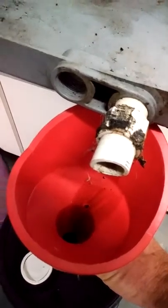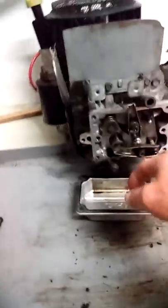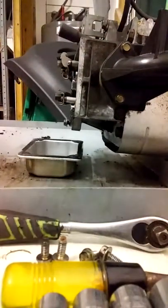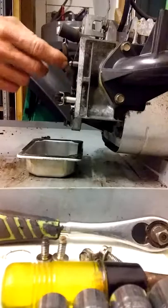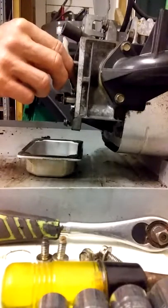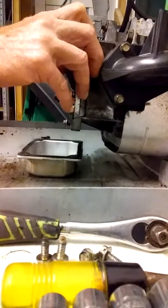If it overflows, I can catch everything with this pan. But there's a problem right here — that little valve was just like that when I pulled the cover off. The bottom valve is not moving at all. My push rod — watch this one, you can see my finger on it. I'll have to work on it, but I gotta get a camshaft for it.